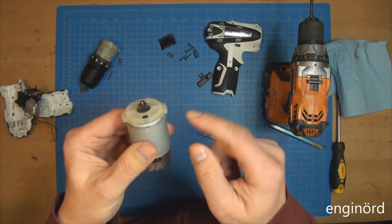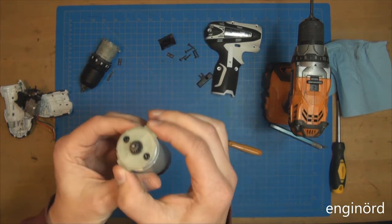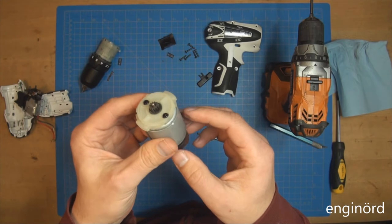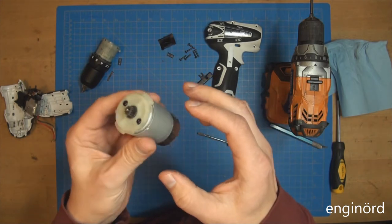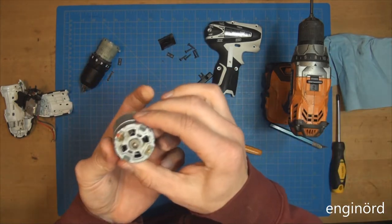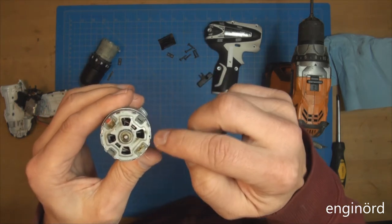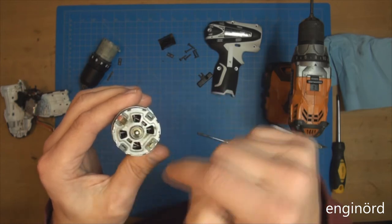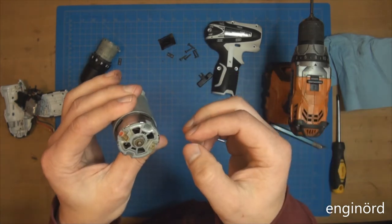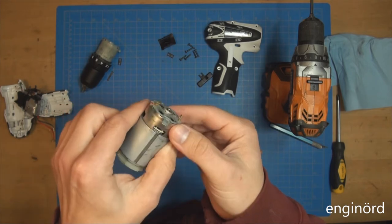Okay, so you can see that the part is basically bolted to this plastic, to this intermediate plastic piece. So I can take these bolts off. It's not going to do us any good because that's not how the motor is disassembled. So the motor is disassembled from this end. So you can see these crimpings here. You can see that there's a plurality of crimpings. So there's 8 pieces around the perimeter. So once we uncrimp those, we'll be able to pull this off and then go inside and look at the motor, figure out what is it that's smoking.